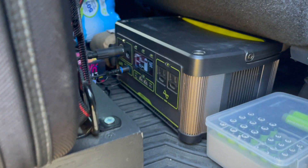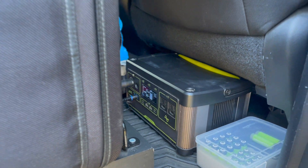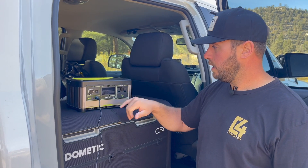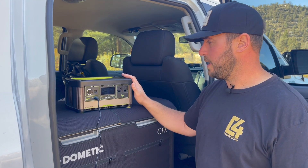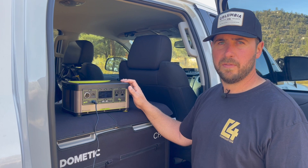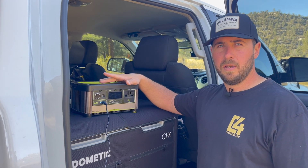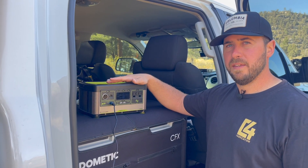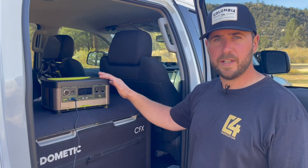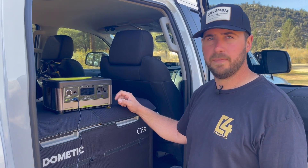So this is where I keep the Goal Zero — the passenger side rear seat, which I deleted. I moved the Goal Zero Yeti 500 up top here so you can see it better. Right now it's four o'clock in the afternoon, partially shaded, so I'm getting 30 watts out of my 50-watt panels — still plenty fine. My Goal Zero is up to 96%; it was down at 70% when I woke up this morning. If I were to do this again, I'd probably get the 1000 or the 1500. During summer when the cab gets hot, this thing gets drained down pretty quick. Winter camping it does much better. Summertime, could definitely use a bigger Goal Zero.